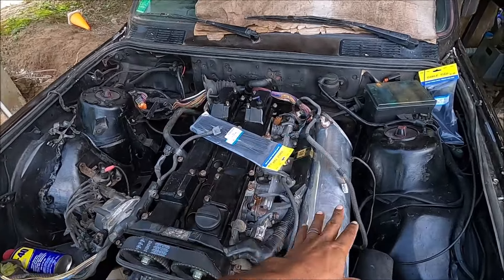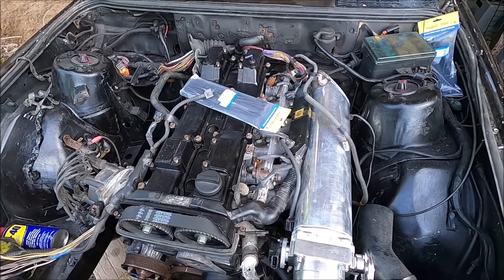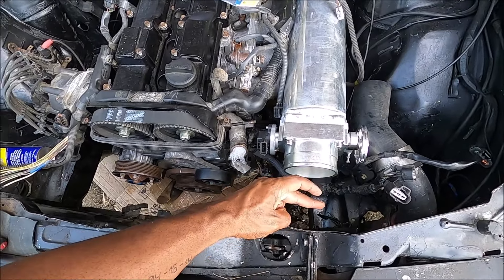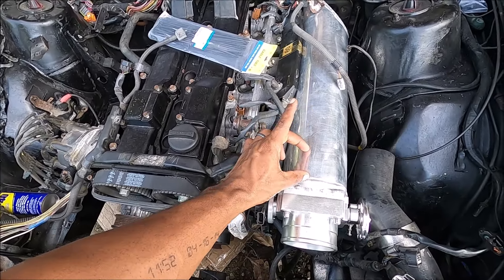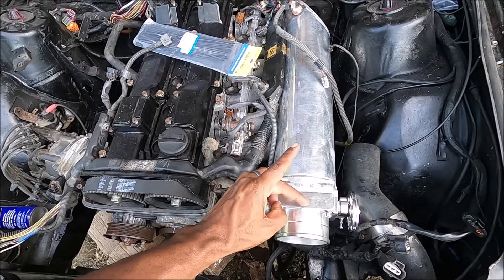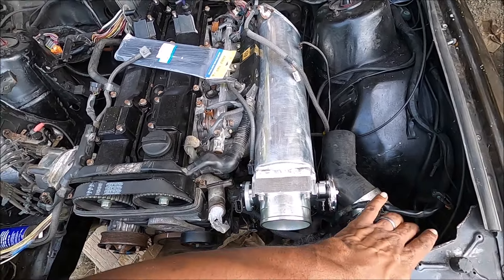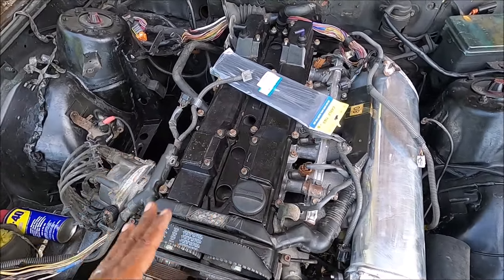The engine is in and I do have the plenum on it. I'm going to modify the plenum a bit - it's a bit too close to the radiator, which will end up somewhere here. My plan is to probably cut off two to two-and-a-half inches, which will let me use a coupler to join this intercooler pipe to it. That's in the works.